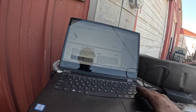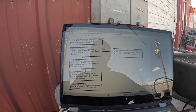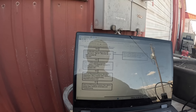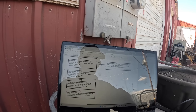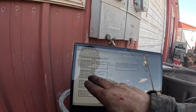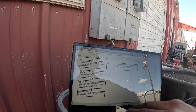Okay, so here's where we're at: PTO speed circuit — we're not going to mess with that for right now. We're going to go to the next step: carry out PTO solenoid circuit test, go to test 8, PTO solenoid, on page 51.